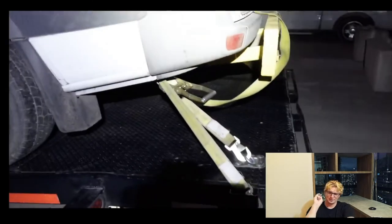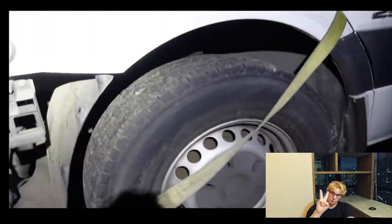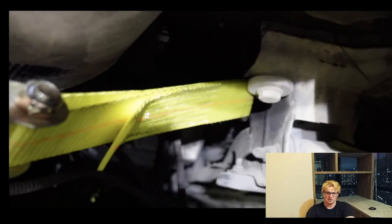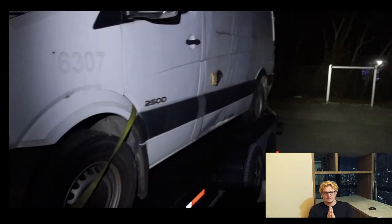Tip number two: if your vehicle's not running — unless you're driving it up onto the trailer and driving it right off — if you need to use a winch, use two people. I cannot stress how important it is to use two people. You might be able to get it on with one person, but I guarantee you it's not going to be easy to get off unless you have two people: one to push it, one to sit inside and tap the brakes. If you're watching this video, it likely means your Sprinter either isn't starting, isn't shifting, or isn't running right. I address all of those issues on my channel — I encourage you to check it out.